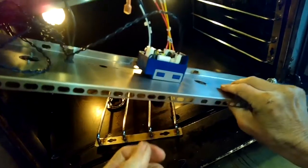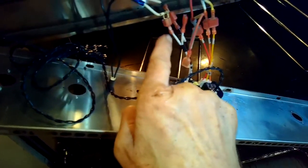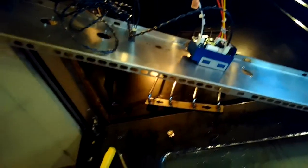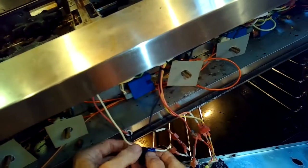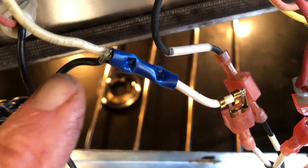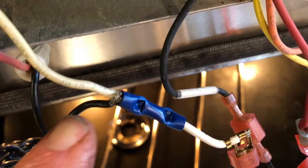I need to do a little bridge from this white wire on the thermostat over to that one. Here's a close-up of that bridge - on the left you can see it's coming over and grabbing power from that white wire that was going to the LED light. Make sure you cover up all your work with electrical tape so there's no metal exposed, because you don't want it to touch and ground out. Wrap that up with electrical tape, get it really tight. Before you put it back together you could just test the circuit - you could turn it on. You'll notice there's a little bit of a delay, probably about five seconds, and then you'll hear the click of the relay and you'll see the LED indicator light come on, and that means you have it all wired correctly.